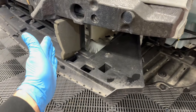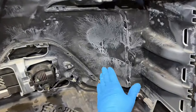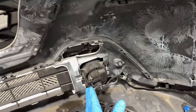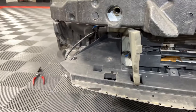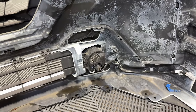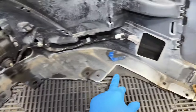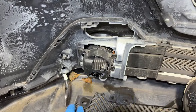There's just one plug on each side, which is nice because they have it on the bumper instead of all the way to the center. The newer Subarus — and a lot of newer models actually — instead of having fog lamps on the outsides of the bumper, they're very center-weighted now, so there's no real way to get in there. You basically just can't get in — they're right next to the opening and it makes it difficult to change those out. So it's easier just to remove the bumper cover. These are the stock fog lights — we're going to remove these. It's what we call a Type-A fitment.